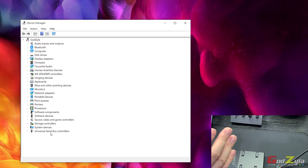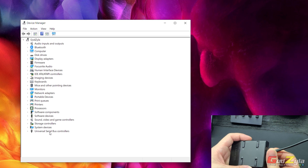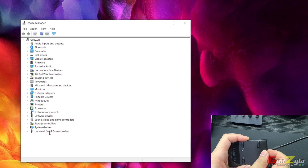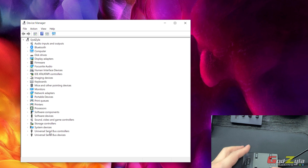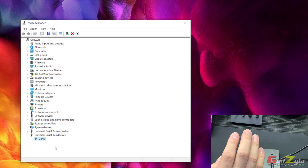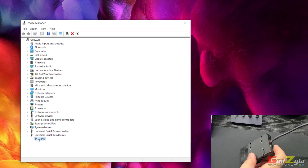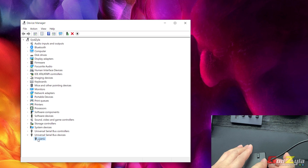You need to install the L Connect application before doing this. Once you plug the USB cable from the unit to your motherboard, you'll notice it flickers on the desktop and a new entry appears under Universal Serial Bus Devices that says 'Lianli.' This confirms the unit is connected and you can sync everything up and use L Connect to control your fans' ARGB and RPMs. If you don't see this, don't panic.